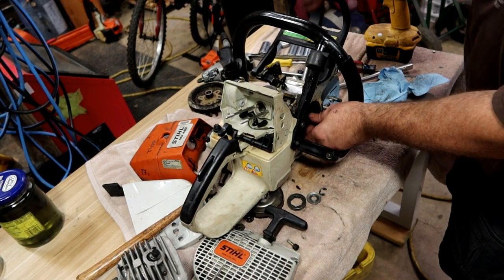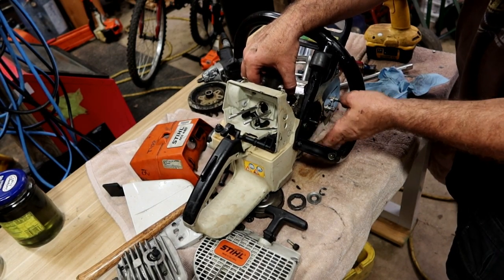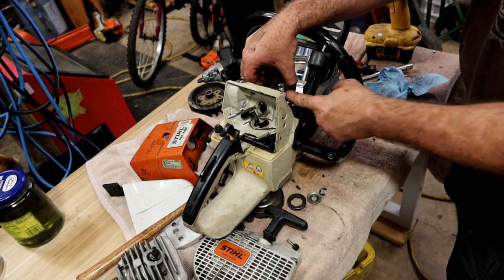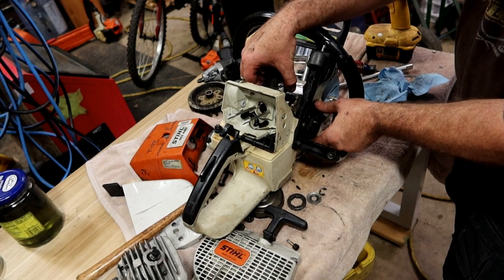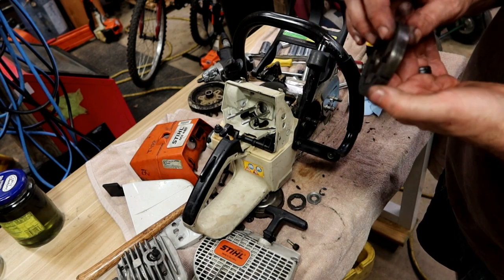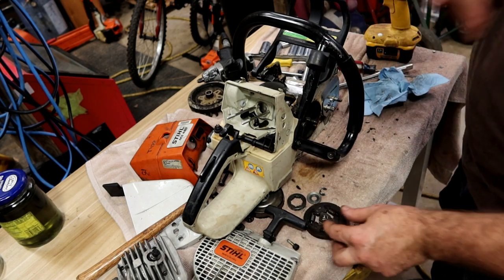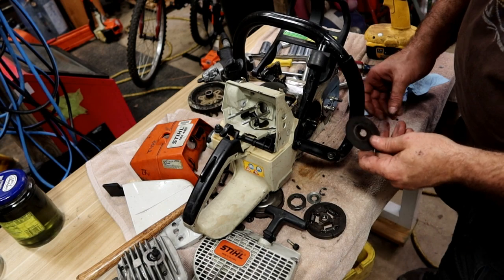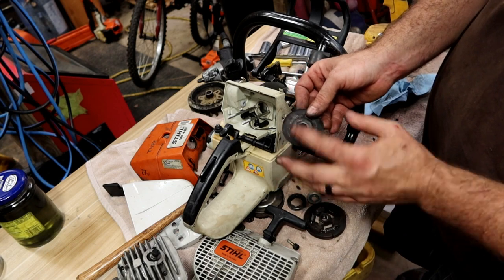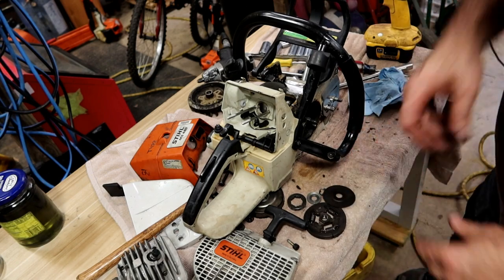Okay. See where that guy's battery died on me. Loosen this up. I had to wedge that piston with a block of wood to get this clutch off of here. The clutch isn't in bad shape. The nut always faces out so you can tighten it. On the ring, the embossed part faces out, the recessed part faces in on the washer.